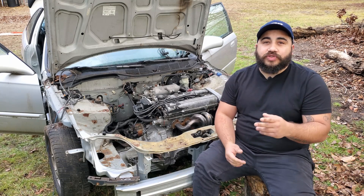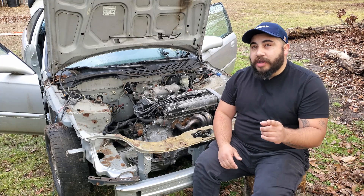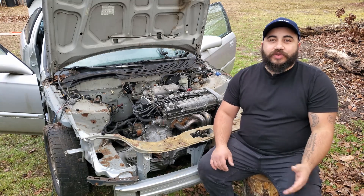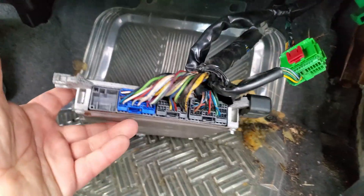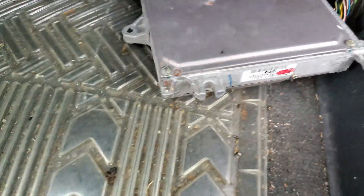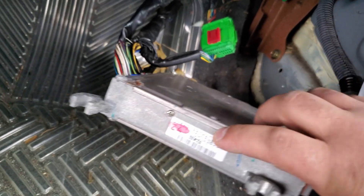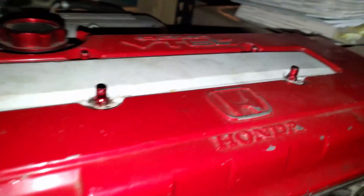You have two main options: you either can keep what your car has — OBD2a or OBD2b — or you can switch it to OBD1, which supposedly brings more power because of ease of tuning. My car is a 2000, so it has OBD2b. I'm staying with the 2000 setup, and this is what my connectors look like on an OBD2b 2000 EX Civic. I'm using my original single-cam harness to see if this thing will run. The ECU code I have is the P2T, originally from the 2000 Civic Si, which I want to run with a VTEC head eventually — I have a B16a2 head which will fit on my B20 block.